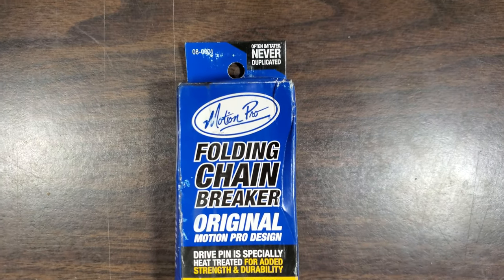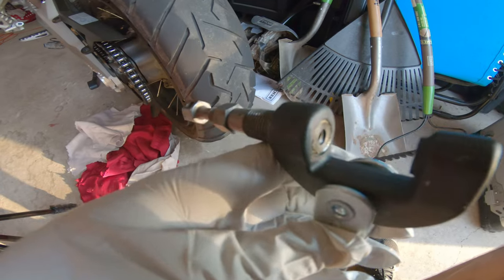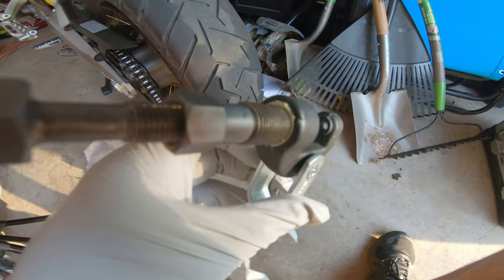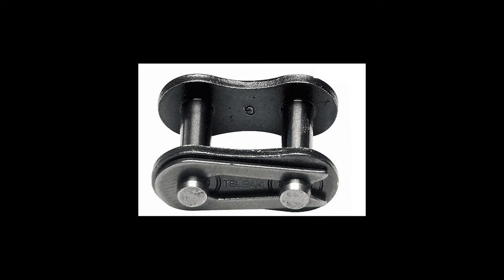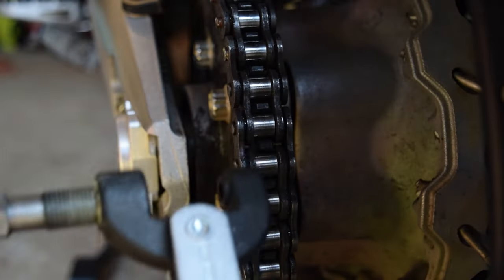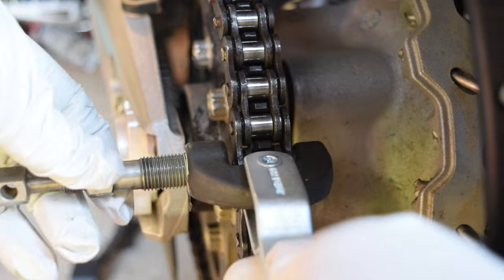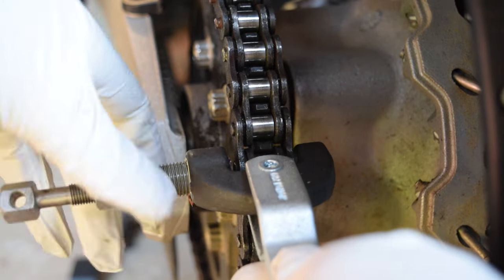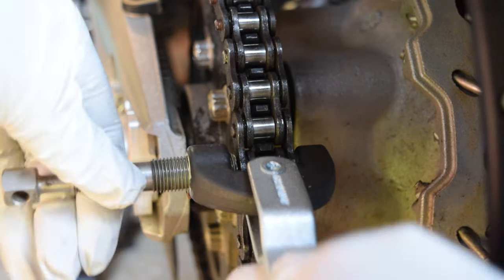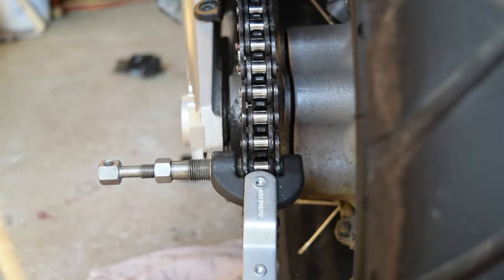This is the point of the first of two mistakes I made during this process. My mistake was not clearly understanding the type of master link which the new chain utilized. I was expecting it to be a clipped master link like all the other previous smaller bikes that I have owned. What I found though is that DID as well as most major chain manufacturers do not make a clipped master link for the 530 size chains, and I did not have a rivet tool. So the second I broke this chain apart I was kissing my upcoming weekend trip goodbye.